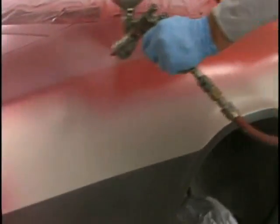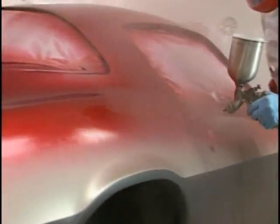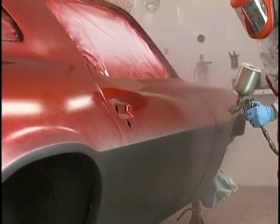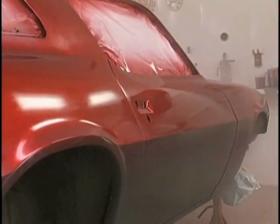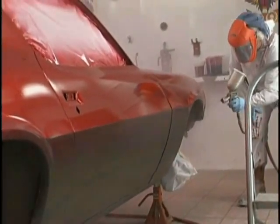We're walking the other side. It's so much fun to do a quality candy paint job, but it does take this type of concentration. Concentrate. Watch that paint hit. Control the hose. Maintain parallel. Aim the gun right. Because we've got the extra reducer in, this is going on so beautifully. Finish in front. Do the wheel opening. Do between the wheel openings.